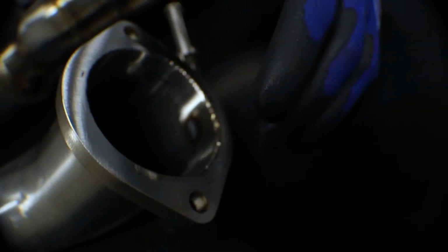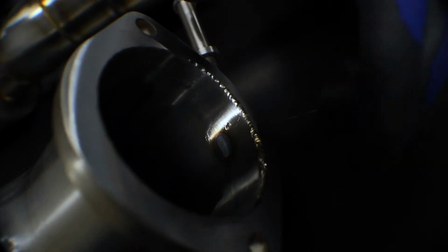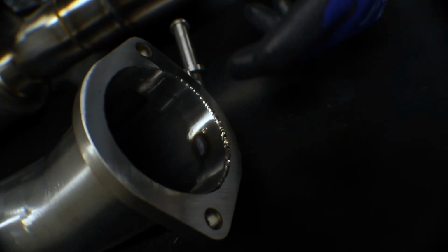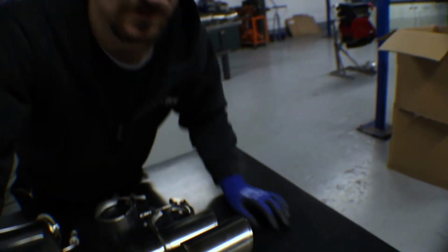They just weld the outside, and you've still got the descaled finish of a raw stainless steel flange. And that means that there's been a lot of heat input to that flange. What will happen is after you've welded it, the stainless steel will actually warp. So you're just never going to get a good seal. You can tighten those bolts down as tight as you like. You can fill it with sealer, but you're just never going to get a reliable seal. So that surfacing is really important.